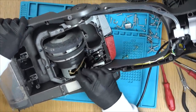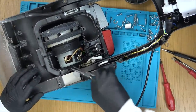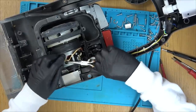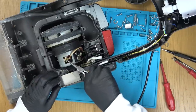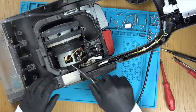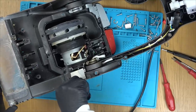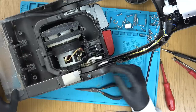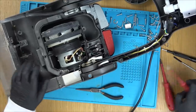Here we go - must have been a little fire in here. Look, that's completely melted - that's where one of the cable ties was. It looks like the winding of the motor has come away. Well, we know it did spin because we heard it. I think it's going to be to do with the brushes. Let's take out this one and see what it's doing.